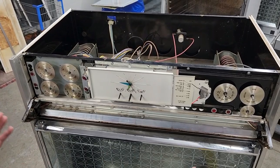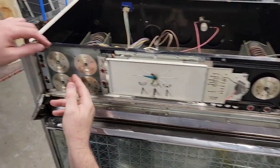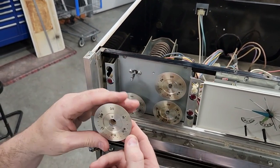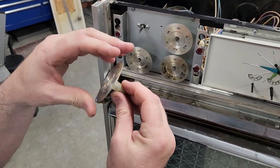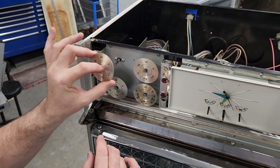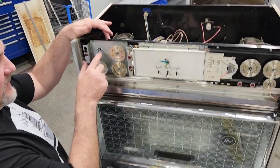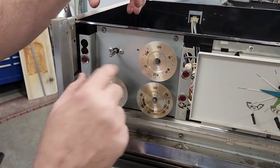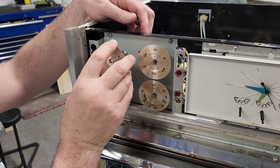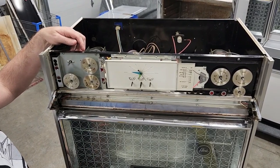Here is what the panel looks like with the glass removed — your burner dials, your oven dial, etc. To get these dials off, come in behind here, push in the middle, and get it unstuck. They have a little O-ring in there that's usually dry and rotted — it doesn't need to be there. The indexing goes on in the back and these just push back on. If we were replacing this switch, these are the two screws to remove. The switch comes out the back, save the screws, new switch goes in, make the new connections on the back, put your screws back in, and put your dial back on.